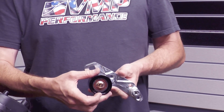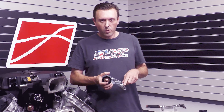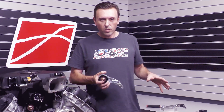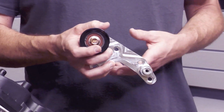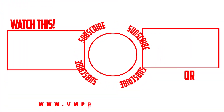This idler has a nice amount of travel up and down. This is what you're going to get in the package with the Atlas bracket, along with fresh mounting hardware. You're going to reuse your lower idler pulley depending on whether you have a six, eight, or ten-rib kit on your Odin supercharger system. This fits all Odin systems we've ever sold for 2011-and-up Coyote Mustang and F-150. I hope you enjoyed learning about the latest creation to come out of VMP. Make sure you like, subscribe, or share, check out the product links in the description, and I'll see you next time.